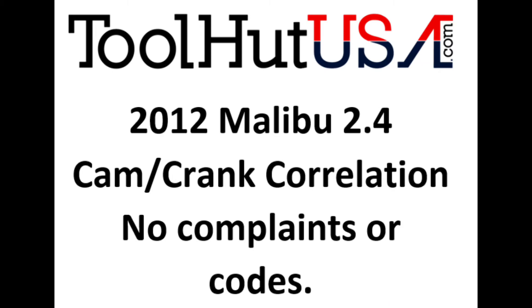This brings up a point I wanted to touch on. If you have a scope, how easy would it be to go to the customer and sell this as a maintenance job? I know this one might be a tough sale since it's not that far off, there are no codes, and no drivability complaints. But I think it's easy to explain to the customer: it costs X dollars today, or after it bends the valves and does further damage — the pan's got to come off to clean it out — it's going to cost a lot more. I see this as the value and power of a scope: you can use this picture to explain to the customer why you're recommending the timing chain today.